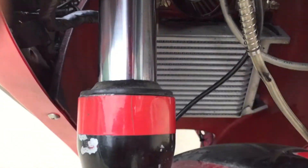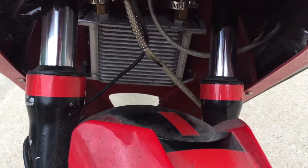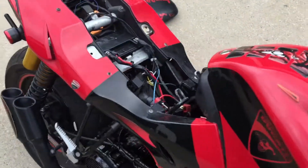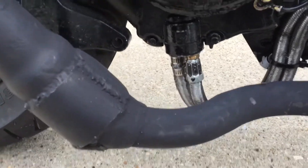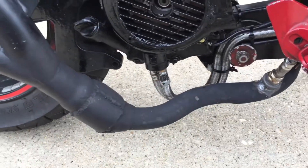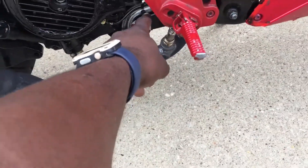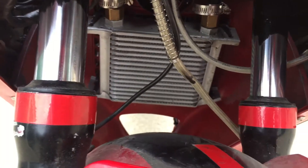Down in here, we got a 16-row oil cooler. I customized my system to take this oil cooler. It's the same sandwich setup that everybody else has, but I made the lines fit. I ordered everything AN8 size, chopped the cords, got braided oil lines, and made them fit this cooler. I ordered the cooler custom and threw it on there. That's a 16-row oil cooler, baby.